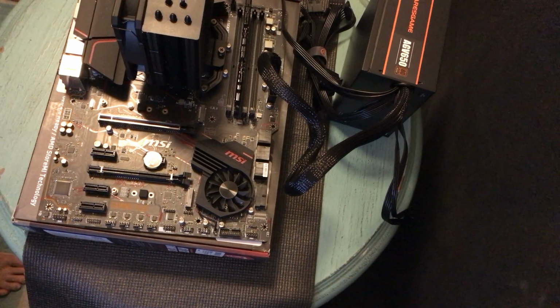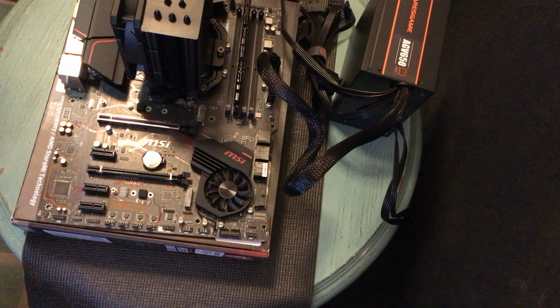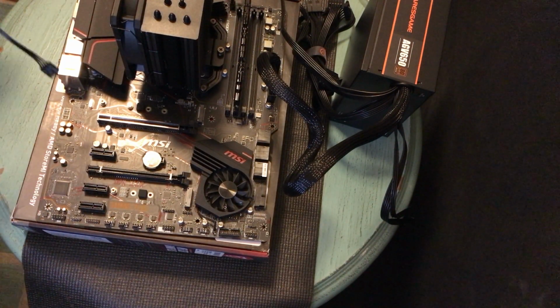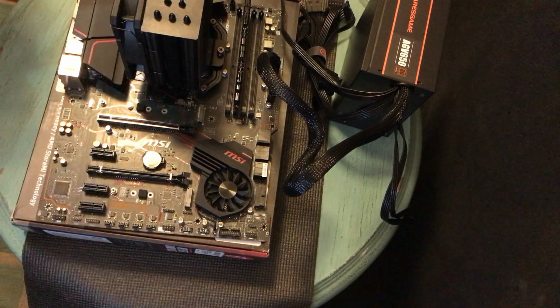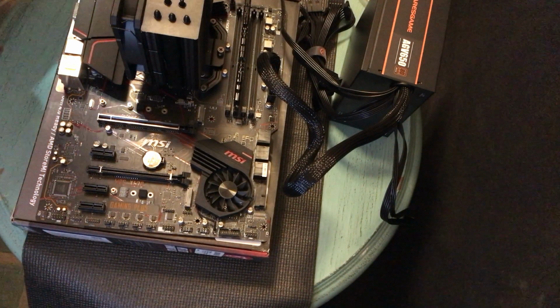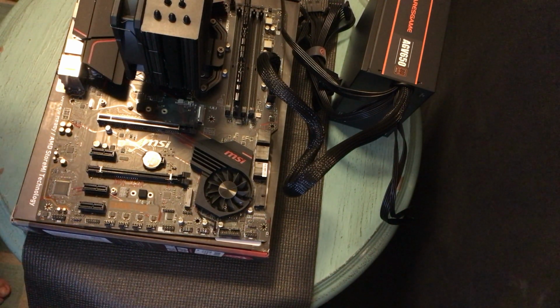Blammo. Oh, and one mistake I've been doing, which I should have known better. It's not really a mistake. It's probably not the best thing. I was just having the motherboard sit directly on the motherboard box. And those CPUs get hot. So if you were to lift up the motherboard and touch underneath, ooh, that cardboard was hot. So what I did, again, I'm cheap, I just got some plastic washers and raised all my motherboards up and off the cardboard just to get air underneath. And that made a huge difference. So that was just stupidity on my part.